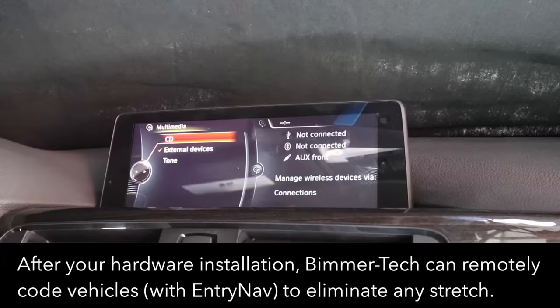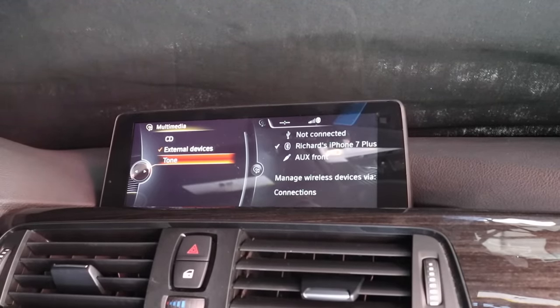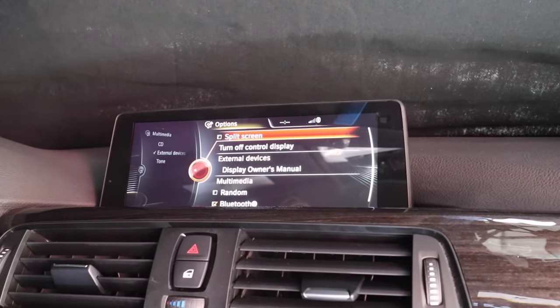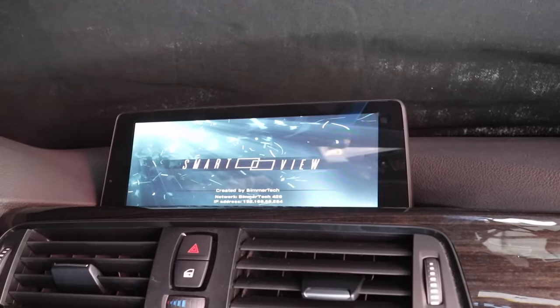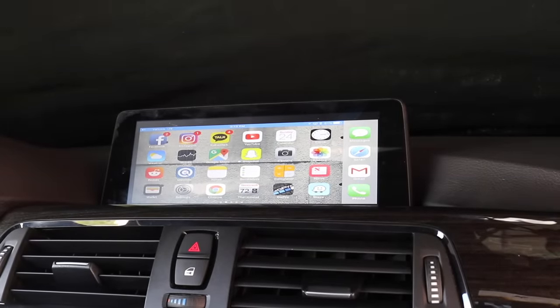Let's go ahead and start the car and take a look. It looks fantastic with absolutely no stretch. If you have entry nav you can code it so there's no stretch; if you don't, there will be just a little stretch. Hitting option puts you into split screen mode — something this car didn't originally have. Holding menu for about five seconds flips over to the SmartView screen, allowing you to mirror your mobile device. Here's real-time mirroring with a SmartView on an iPhone — this system also works very well with Androids. Again, this is Brian — thanks for watching Keys Motorsports. Visit us at keysmotorsports.com or email info@keysmotorsports.com. Give us a like, subscribe, and stay tuned — thanks for watching, have a great day.